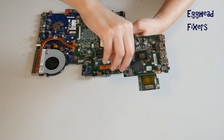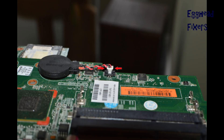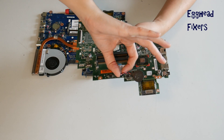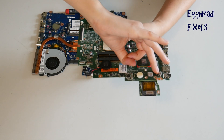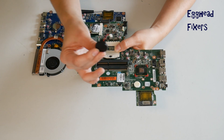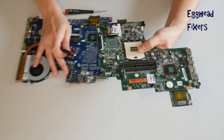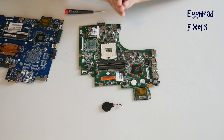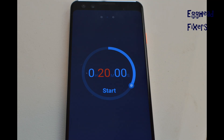With the wired kind, you have to locate the two plastic tabs on the side. Put one finger on each side and gently pull up, being careful not to break that cradle. Once you break that cradle, it's extremely unforgiving — sometimes it damages the motherboard to the point where you can't use it anymore. So you have to be careful. Now that you've done that, go ahead and set your CMOS battery and motherboard aside for 20 minutes.